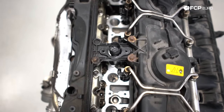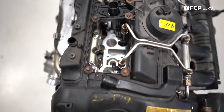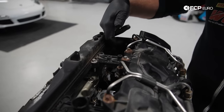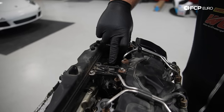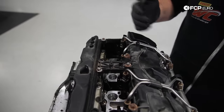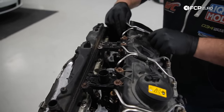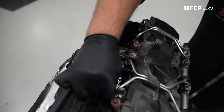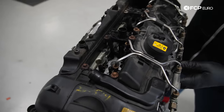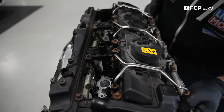This will be the easiest injector removal you ever have on one of these engines. Most notably, you'll see this big opening here. That's not how these would normally look. There is a secured spark plug and injector recess that's bolted to the cylinder head that has been removed on this engine for whatever reason, probably when they swapped it over to the other engine, they needed those parts. So literally these injectors are just sitting in here. Don't need a pull or anything to get these out because they're technically not really installed. And then we'll just go ahead and yank this entire assembly out.